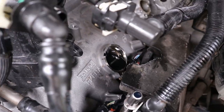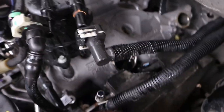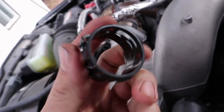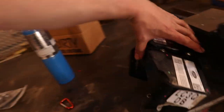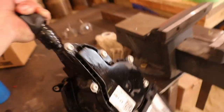So let me go over what I did there. That hole in the back has two screws on it — those are your two hold-down bolts — and you got one up at the front and then there's another one there. This line has to be disconnected, and then you pop this little clip off. The clamp has three little keepers on it, you just have to pry those out of the way and that sucker will pull off. Mine slid up this little collar and the hose popped off. Not too bad — about 10 minutes and I already got this sucker off. Here is this big ugly piece of crap. There's your two rear bolts, your front bolt, and your top bolt — this is what we're deleting today.